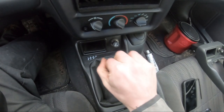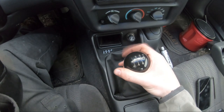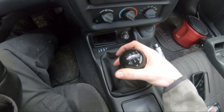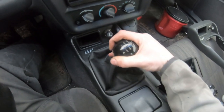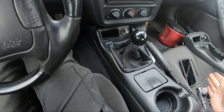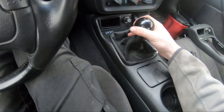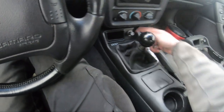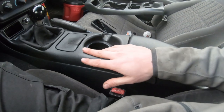One thing I will say that I noticed about this: it is a lot more firm and it's shorter. First gear is there — it feels like it's not in gear but it is. Basically it makes it way shorter, but it also kind of does make reverse really hard to get to. So if you're not a fan of notchy gears, don't do a short throw shifter. But I personally think this is way nicer of a feel. With that replaced, the color doesn't mismatch as much as I thought it would, so it definitely looks a lot better in here.